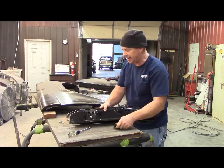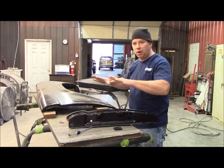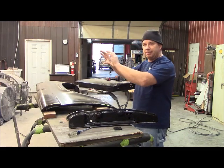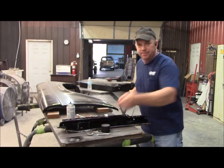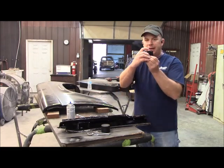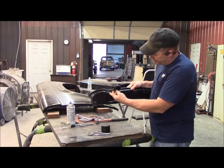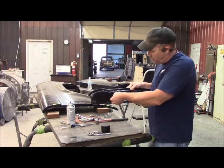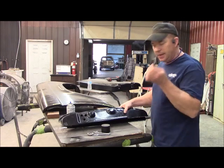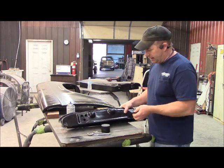This is going to help more than anything. Once I get all that adjustment where I need it, I'll put it back on this fender and center it. I pulled these hinge plates out — they're inside there in a cage that lets them move around. I've cut quite a bit off, getting the threads up closer to the hole so now I have full adjustment; the bolt will actually go all the way up in the adjustment area. Before, it wouldn't even go halfway. If they would just change these two items in this kit, it would make a huge difference. I went ahead and sprayed some black paint on it where I cut it, and I'm excited to get this back in there.